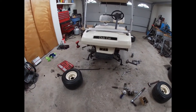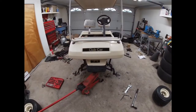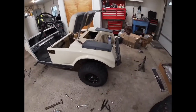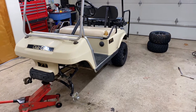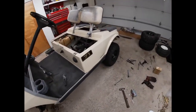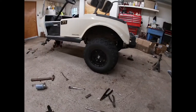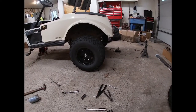There's a little spacer plate that goes underneath the front leaf spring, then I'll put that in and move on to the back. We got the lift kit installed — front and rear done, all re-bushed. It wasn't a terribly hard job, though the instructions do leave a lot out. I got the back side all done with all new bushings, bolts, and hardware because it was just corroded and rotted — while you're there you might as well get it done.